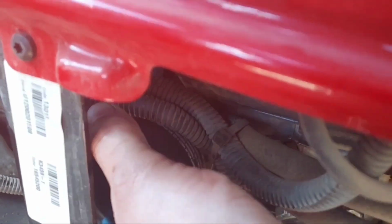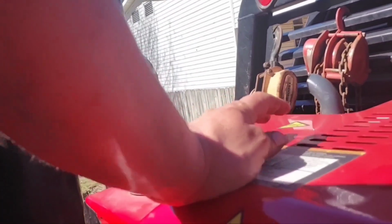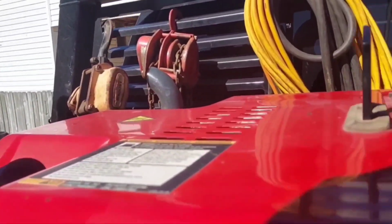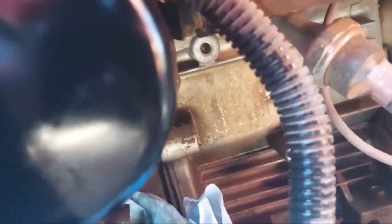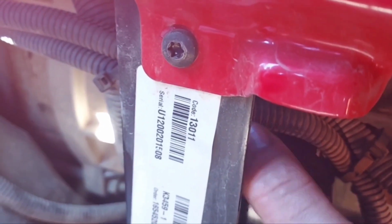Alright, the gasket makes contact right there. Make sure there's no wiring in the way, because there is a little small wiring harness that runs right down through there. It's highly annoying. I'll slide that out of the way, and then, well, okay, yeah, I'm actually using the camera as a mirror, so that's good. Once the gasket makes contact, all you need is a quarter turn. That's all you need. Quarter turn. Gasket makes contact.